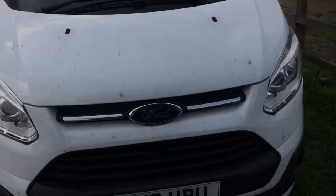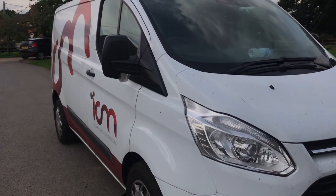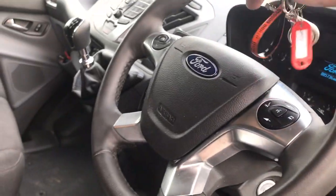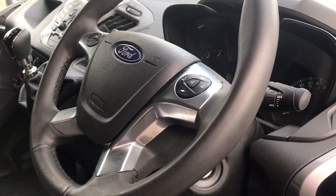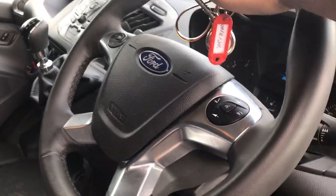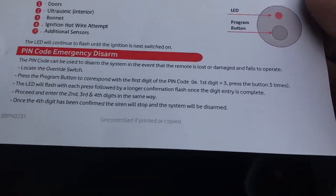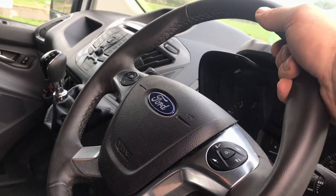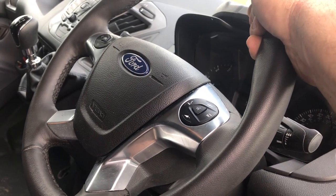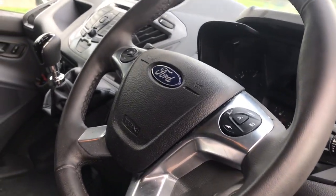Battery backup sirens — somebody asked why it's so important. This is a coded battery backup siren. This alarm is category 2 to 1, so it uses the existing Ford PATS transponder immobiliser to make it category 2. Category 1 status comes from the battery backup siren — it's a wireless one on this Cobra system. What it needs is a coded arming and disarming signal, so if you find the siren and cut it, the battery backup siren will continue to sound. If you cut the negative or positive, it's a wireless trigger — if power is absent and the alarm is still active, it will just keep going.